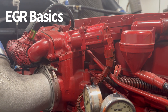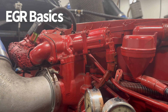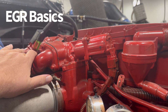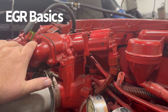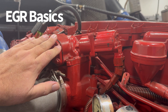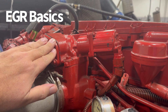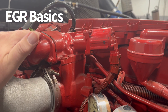The reason behind EGR is that we're trying to get rid of NOx, and the computer controls this because if we just straight-piped this exhaust flow into the cylinders, you would have a rich exhaust content in your cylinders, which would make for very poor combustion when there was a high demand for power — and we don't always want to do that. If you have a fully loaded tractor trailer and you're trying to take off from a dead stop going up a hill, the last thing you want is this valve open and reducing power.